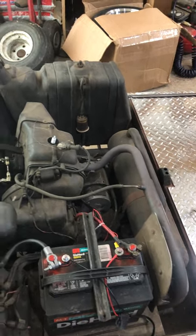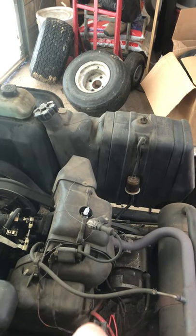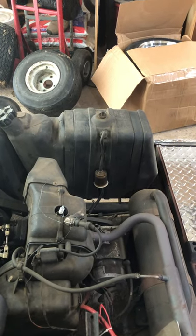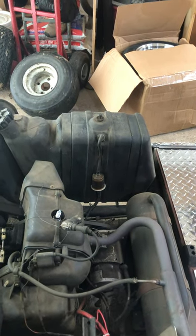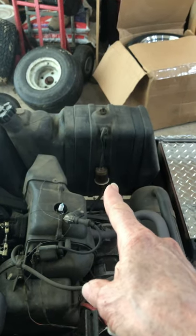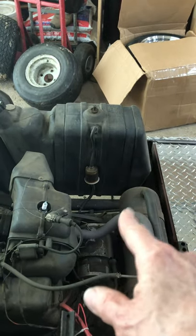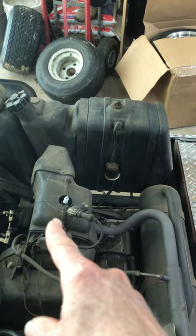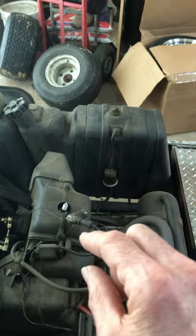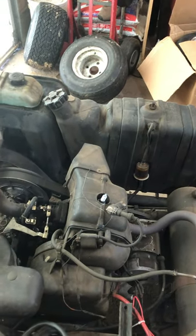We went and cleaned and charged the battery and filled all the cells. The tune-up kit we got — I think it came from Amazon — I'm going to list in the description where everything came from. We didn't put the new oil or gas filter on because we're afraid that might spill, so we're holding off on that. The spark plug that came with the tune-up kit was longer than the one in there now, so we're trying to replace it with what we took out.